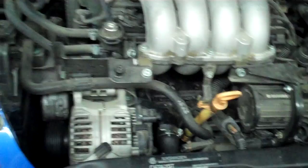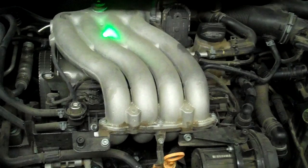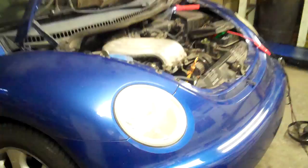I recommend replacing the timing belt and water pump on these at 90,000 miles, if not 90,000 then at least at 110,000. This one's at 116,000 miles, so it's just due to be replaced. So we're going to be doing the fuel pump, the water outlet, radiator fan, timing belt, and water pump — this thing's going to keep me busy today. These are all really common Volkswagen problems, especially on this 2-liter motor. This is the MFI multi-port fuel injection — you can tell because you can count the injectors: one, two, three, four.